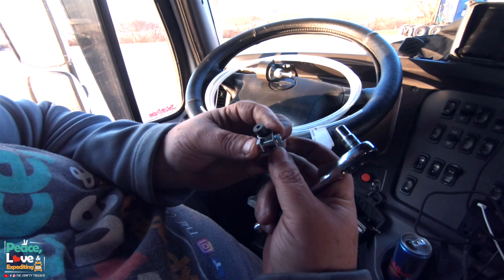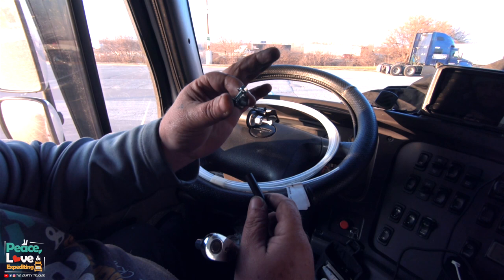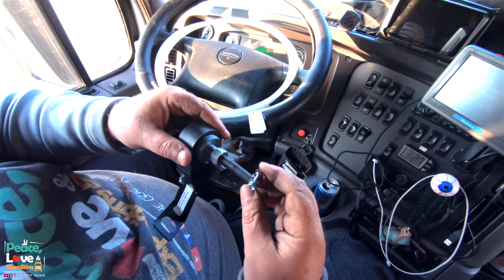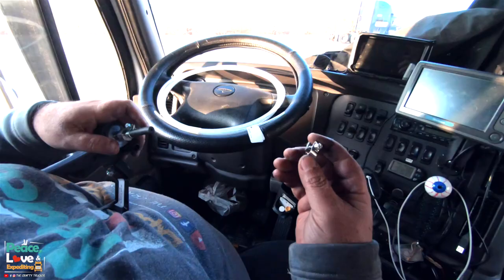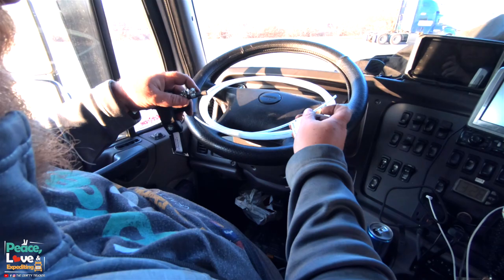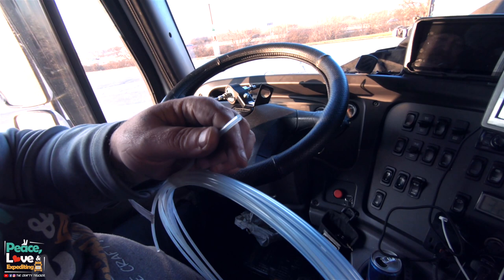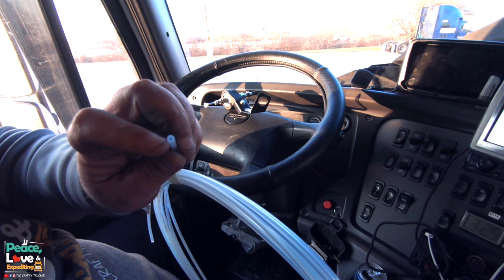So we have some fuel splicer line right here, these hoses. What I'm gonna do is I'm gonna connect one of these to the end of the fuel pump and attach it with these hose clamps. Next, we're gonna attach another hose clamp, put that on there. Then what we're gonna do is we're gonna feed some of this down into this hole. One thing I'm gonna do is I'm gonna use my hose cutter to get a nice clean cut on there. So then it's a nice, even, flat, squared cut and perfectly leaves enough, doesn't damage the hose at all.